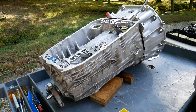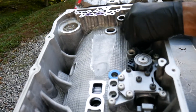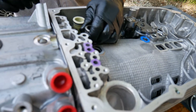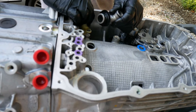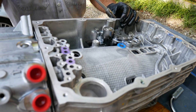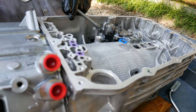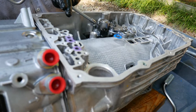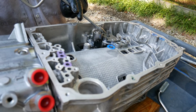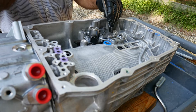Here we see the pickup tube for the engine-driven vane-type pump and the discharge back to the valve body. There's simply one aluminum fastener with a shoulder; it's lightly seated against the aluminum-magnesium case and slips right out. Be sure to gently lubricate the O-rings on installation. Here's the parking pawl mechanism, held down with T30 aluminum bolts. It has an electrical solenoid, but the parking pawl can be locked or released either electrically or hydraulically. The piston moves hydraulically in one direction while a powerful spring pushes it back — the default spring-extended position is park.